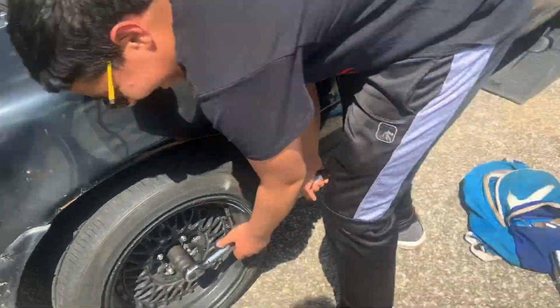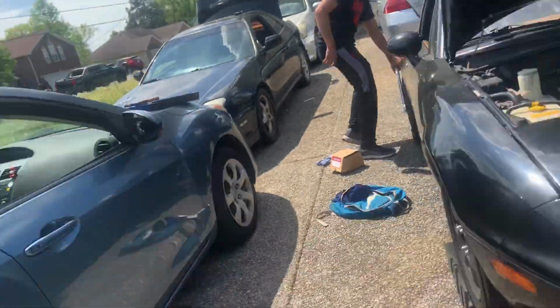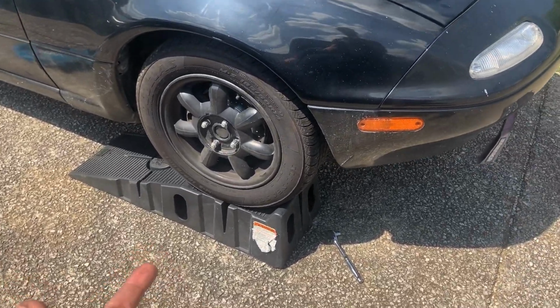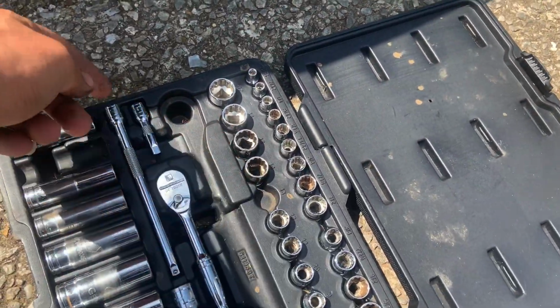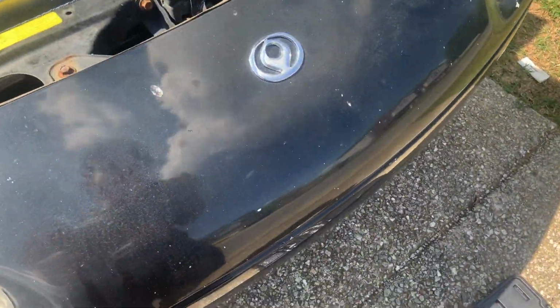He wanted to change the oil. He said a lot of people wouldn't know how to change the oil, so Macarius doesn't know how to change the oil, of course. But it's pretty simple. Just get your car higher off the ground. On my NA Miata, it's a 13mm socket. That's what I'm gonna need. This is what you need for the oil change, basically. And you need your specific oil and your specific filter.